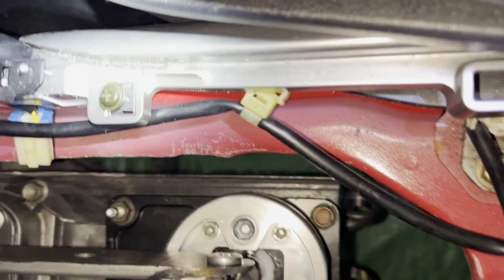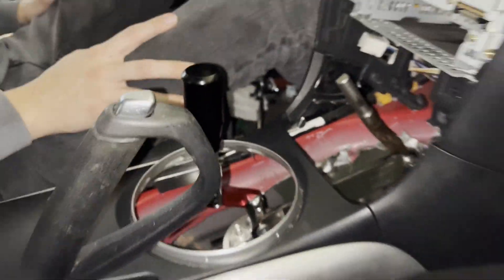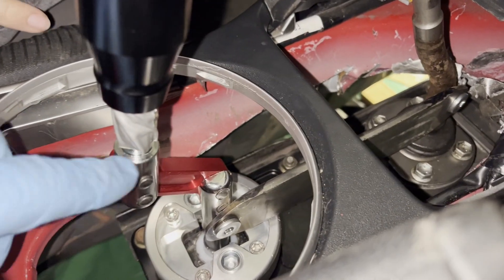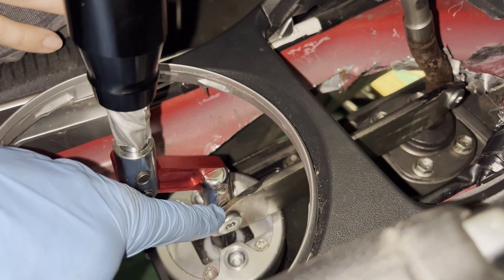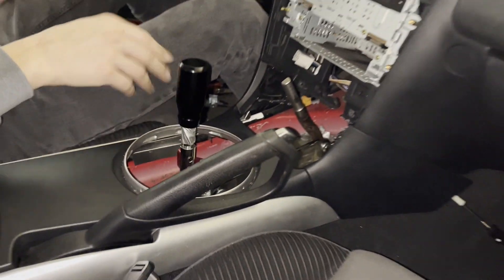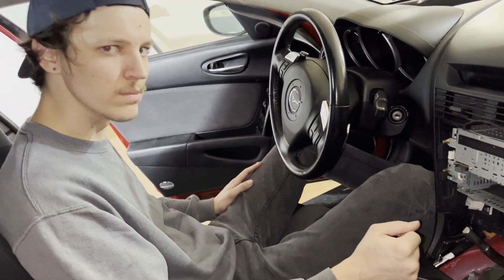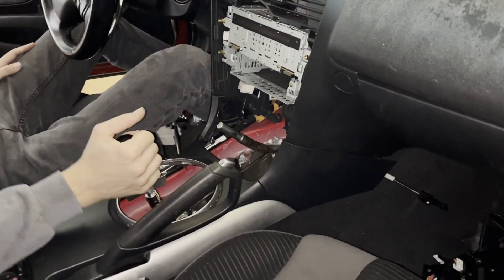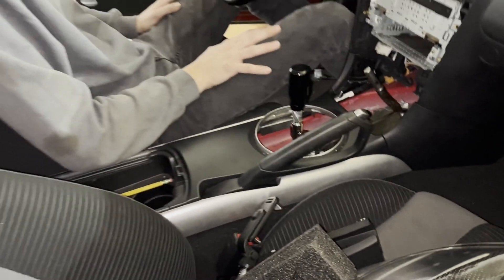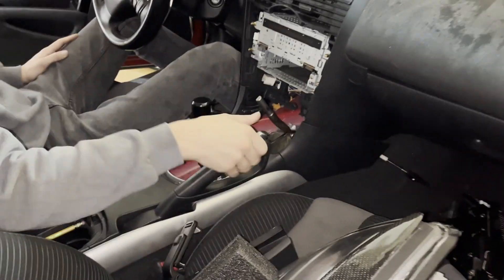One fix would have been tighter tolerance — I might be able to shim it somehow with a washer. We just got the shift knob on and Nick's going to do a little test. It turned out really well — it feels very solid. The only issue is there's a little bit of side-to-side play because I cut my linkage too thin. Nick suggested making a little plastic bushing or plastic washer to put in between there to fill up the gap and make it nice and solid. All that's left after that is to chop off the top of the old shifter and this one's complete — check it off the list.